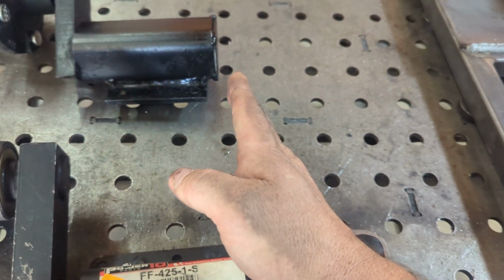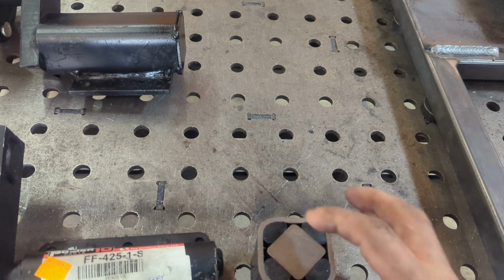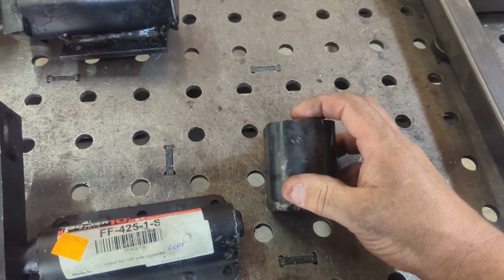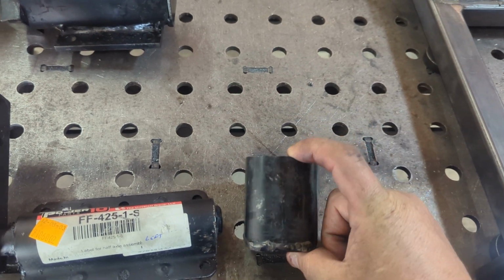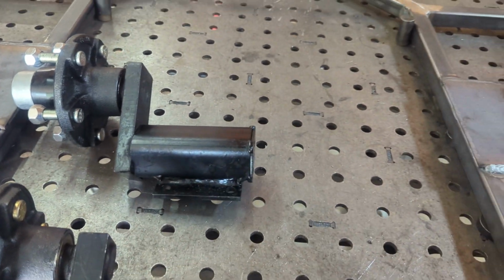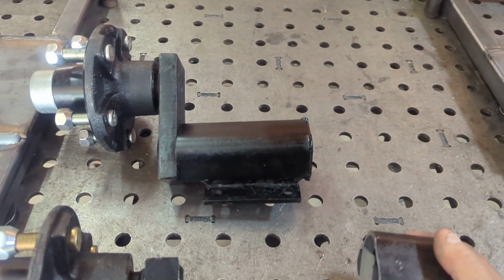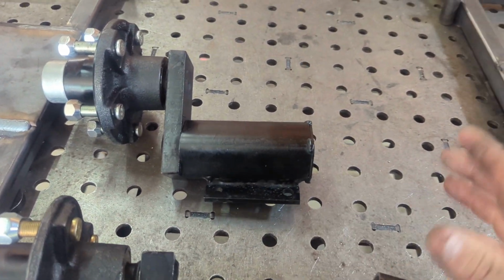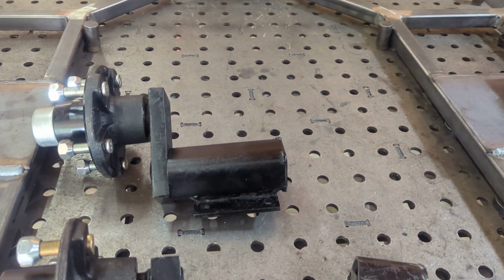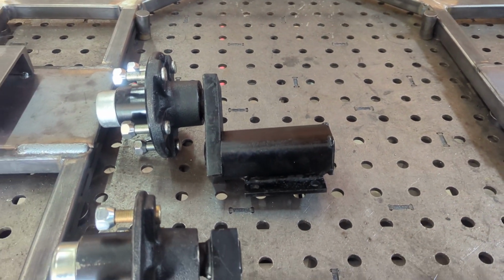So if you cut a percentage of it off, it doesn't change anything inside, because it's just literally 4 pieces of rubber and a piece of metal that's in the middle, but you change the resistant weight. So we did some testing, and cutting this much off right here makes it 200 pounds instead of 250. So it's 400 pound sets instead of 500 pound sets. So it does two things. First thing it does is it shortens it, so we don't have to worry about it hitting the bags on like a Honda Gold Wing or an Ultra Classic or Road King, and it lightens it up,